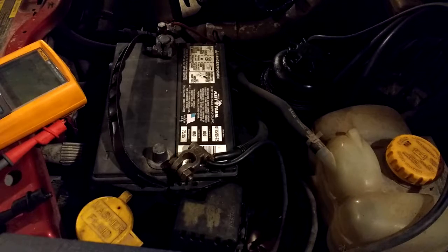What I'm going to be doing here is basically testing the parasitic load that the car puts on the battery when it's not running. I want to find this out to make sure that this car doesn't have any outstanding issues that the battery would cover up by having a larger capacity than the bank of capacitors.